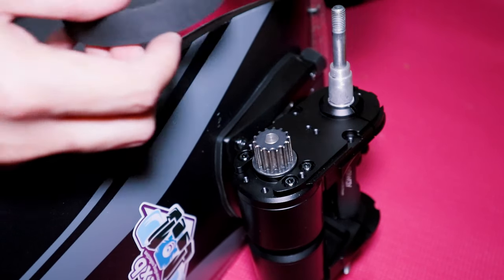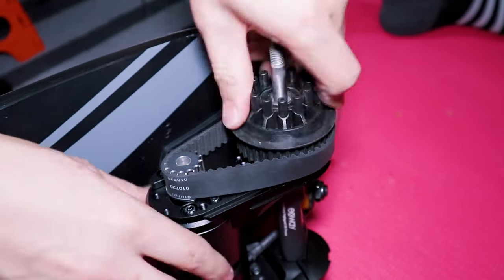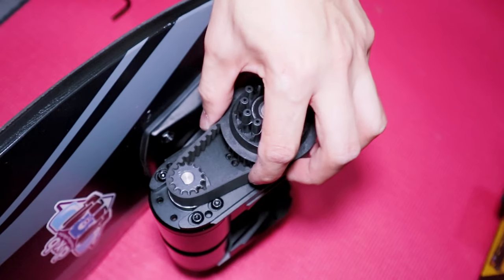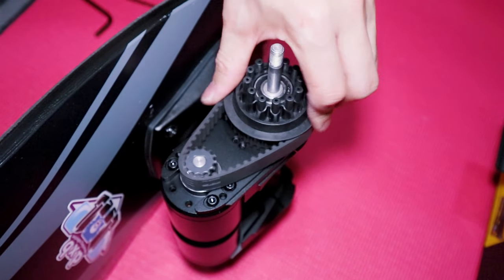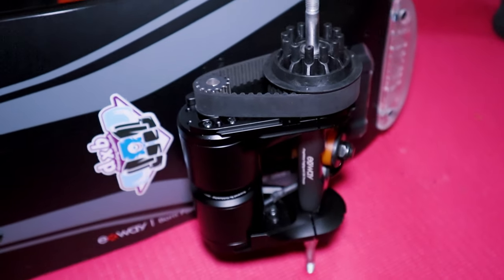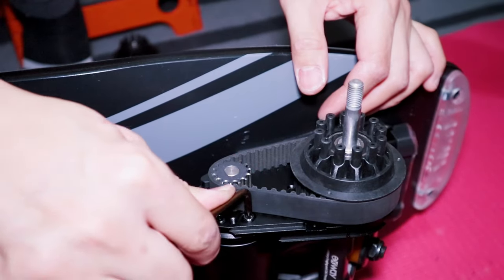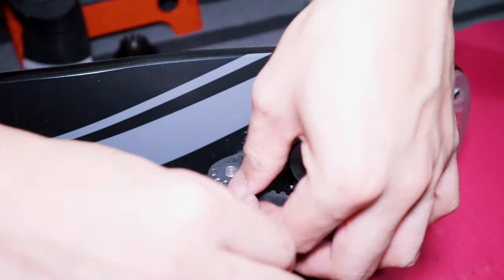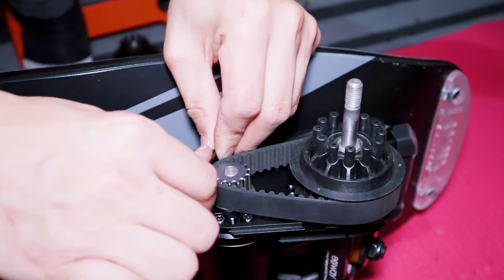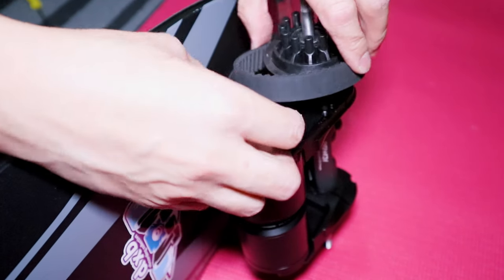Insert the belt and wheel pulley with the small bearings returned to their place. To check the tension, hold the motor and try to squeeze both sides of the belt, exerting just a little pressure — this helps you see the right tension. I prefer to make it slightly loose, as this helps prolong the lifespan of your belt, makes kick-pushing easier, and gives more range to your board. Once done, tighten the bolts and remove the wheel pulley and belt again.